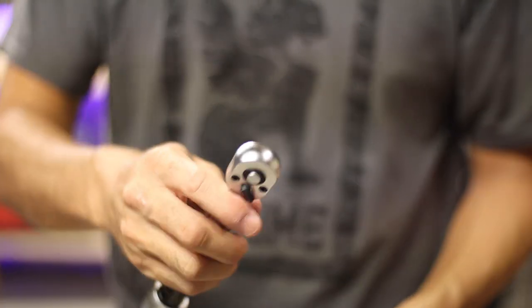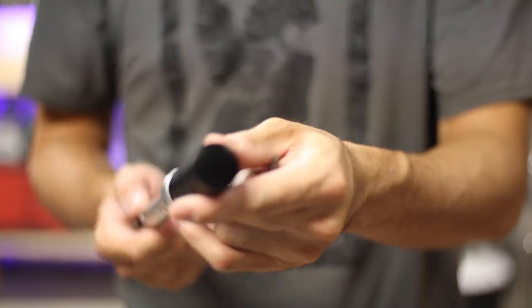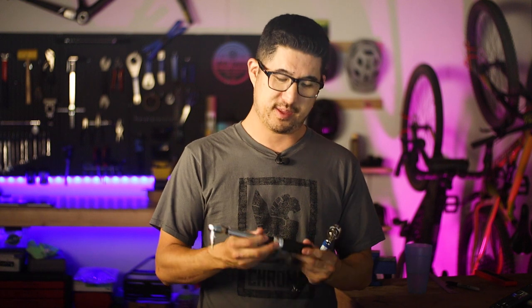The budget Handife tool, on the other hand, employs a slightly smaller quarter-inch drive, yet spans a larger range of torques from 5 to 25 newton meters, which is biased a little bit higher than the Park Tool. The knurled metal handle is pretty typical for a wrench at this price point and it's functional. There is a trade-off here, because the Park Tool is capable of torque starting at 2 newton meters, and while the 5 newton meter minimum of the Handife seems close, there are plenty of bolts on a bike that call for torque specs lower than 5 newton meters. The Park Tool also tops out at 14 newton meters, so the limited range is just a fact of life with torque wrenches, and it's the reason many mechanics have multiple torque wrenches spanning the entire spectrum of required torque specs.